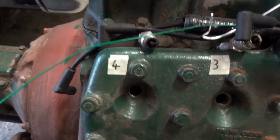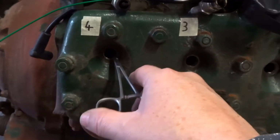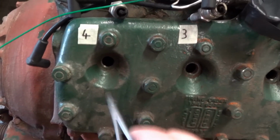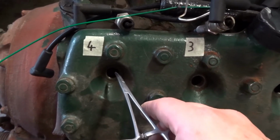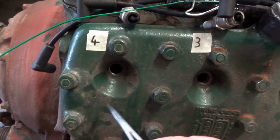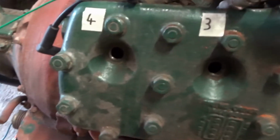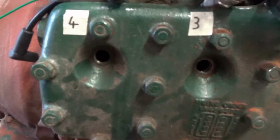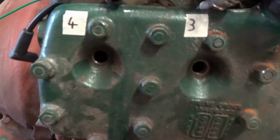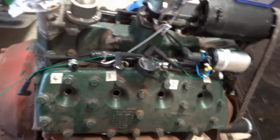So to put a bit of oil down each cylinder, of course, on a flathead engine, when you take the plug out, you're not looking at the top of the piston, you're actually looking at the top of the valves. In this case anyway, the piston is here and then the valves are here and here to the side of it. So from the inlet manifold the mixture comes in and has to flow over the top to get to the piston, and the same with the exhaust. So that's why flatheads aren't particularly powerful compared to a system with overhead valves, even whether they're operated by push rods or an overhead cam. On the other hand, this is the simplest way to engineer an engine, so it kept the cost down when they were producing this, what was in fact a low-cost V8.